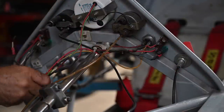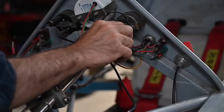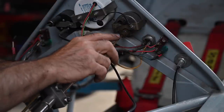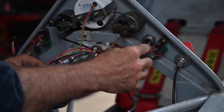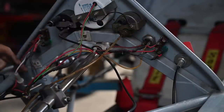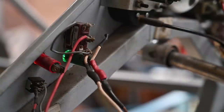Let me give you a back view on how that cabling is done. You can immediately see this is a really tacky job. This is the oil pressure line coming into the oil pressure gauge - I might replace this with an electrical one because if this hose jumps off you get lots of hot oil on you. Look at the state of the switches and warning lights - this is really not good. Some of the stuff is actually loose and came off. All by all, the cabling will have to be redone on this car completely.